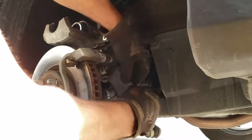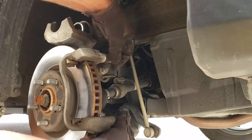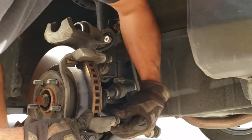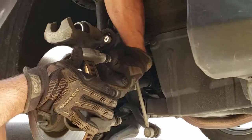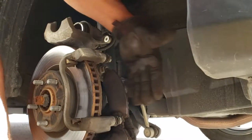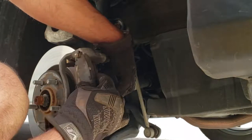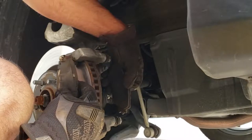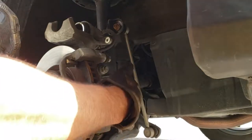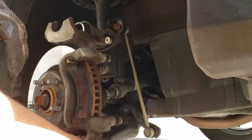Worn down pretty good. A lot of times the rear will wear more than the front if these aren't sliding. They are kind of moving — they're pretty stiff, but that moves actually pretty good. But if these are stiff and not moving, then you'll be using that piston on the caliper and pushing just the rear pad. What happens is as it pushes on the rear, it equalizes the pressure by letting that slide. So they get 50-50 wear, and that's a really good sign. So if you have more wear in the back than the front, these are not sliding — you take them apart, clean that out, re-lubricate them, and put them back together.